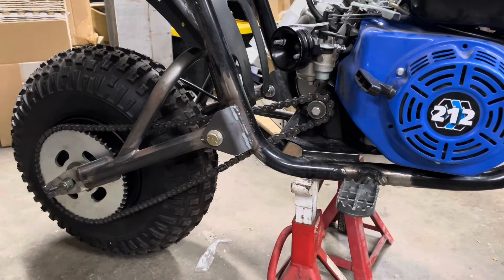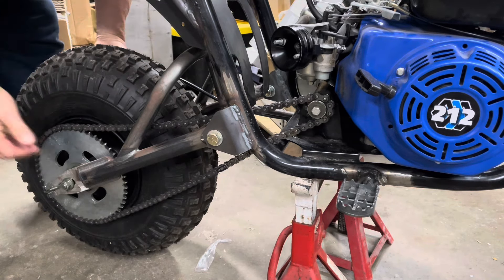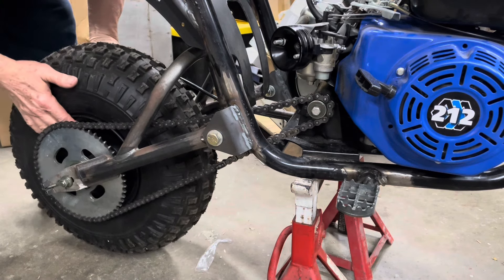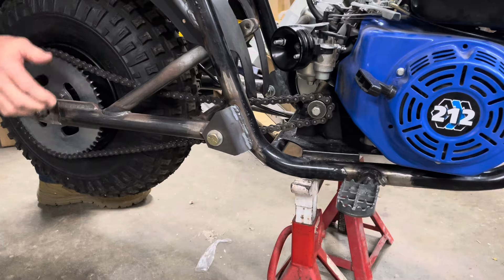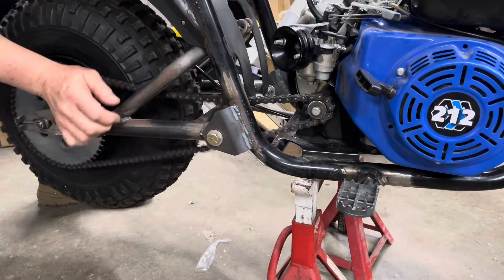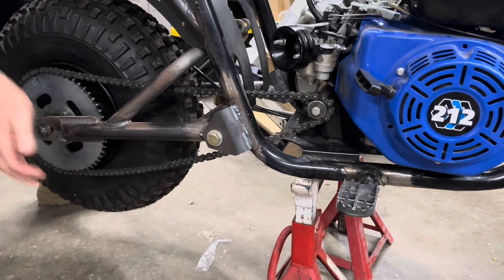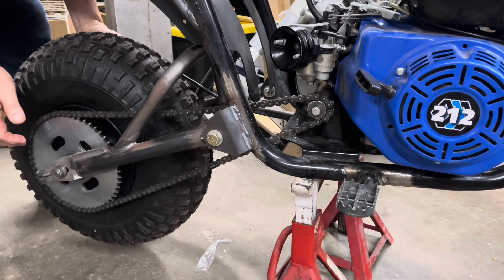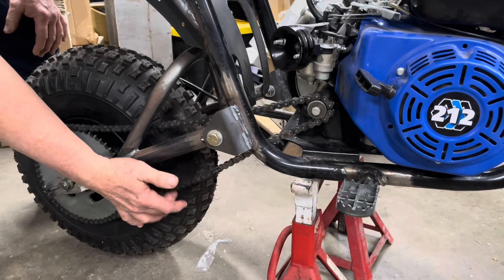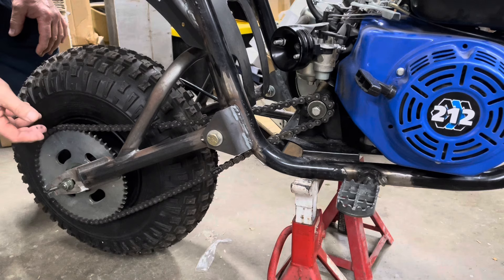Let's take a look at the travel of the rear wheel here, minus the shock, and how it affects the chain tension. Right here where it's at, when you lift the wheel up — this is probably extreme travel, it probably never travels that way. But like this, you have quite a bit of slack in the chain, which could cause it to jump. Down here where I test-rode it is not bad. Of course the chain's going to stretch — this chain's not that old, but any chain you put on is going to stretch.